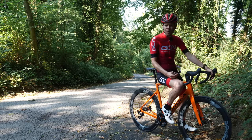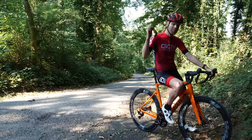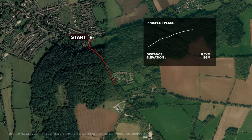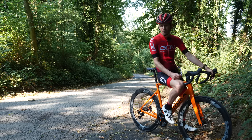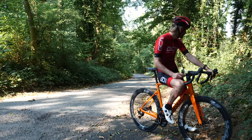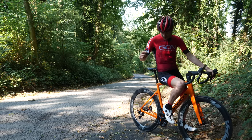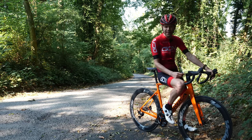I'm next going to ride both group sets up the steepest, most horrendous climb that I could find near to me. This behind me is Prospect Place near Bath. It's said to max out at 25%, according to the sign, but my Wahoo regularly seems to read over 30. It is truly horrific. Now, why am I putting myself and the group sets through this? Well, hopefully for you watching at home, it's quite amusing watching me grovel on this horror show of a road. But also, I believe this is a good way to demonstrate that 105 hasn't just caught up with Dura-Ace. In some ways, it's surpassed it.